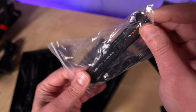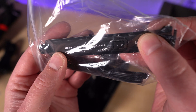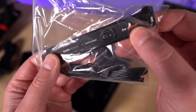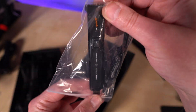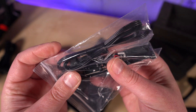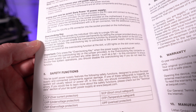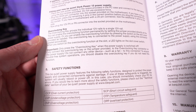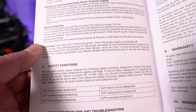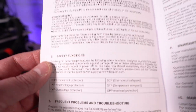There's also a back plate for overclocking your power supply — it has a switch and the Be Quiet Dark Power logo. It's a very classy black back plate with a wire that connects to the back of the power supply. After reading the manual: the overclocking key groups the individual 12-volt rails into a single 12-volt rail. You can enable the overclocking function permanently by setting the jumper provided directly at the power supply.